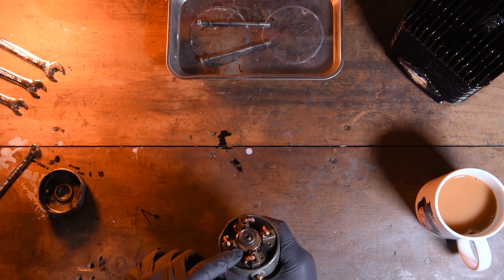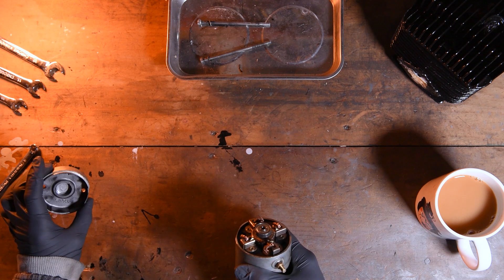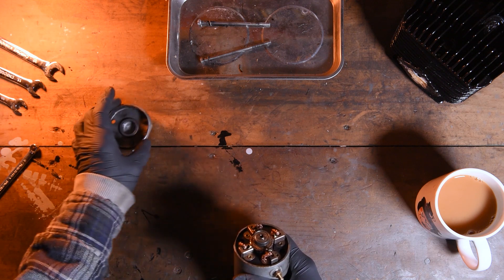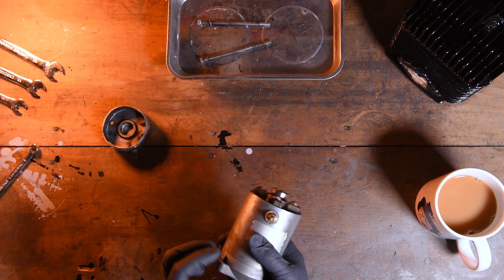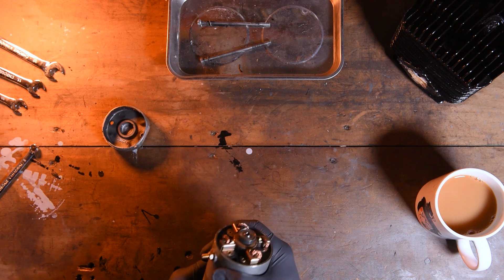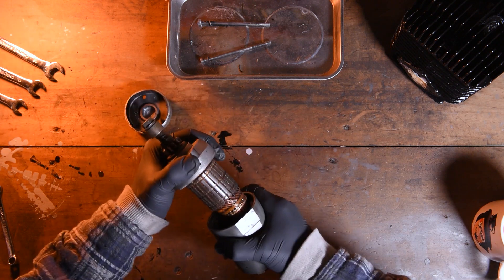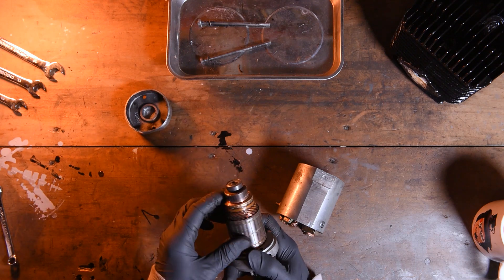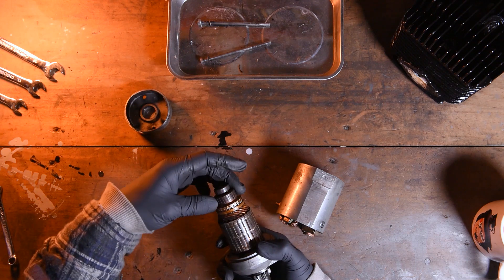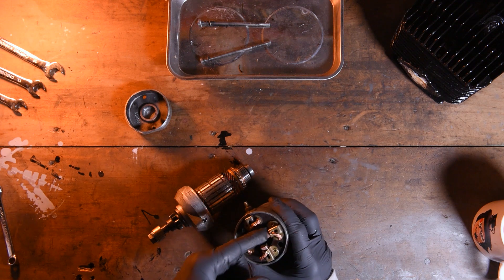It's probably going to be ever so slightly stiff so just work it off with your hand like so. That shows you all of your brushes and the solenoid inside. As you take this apart, carefully take bits out and make sure you can see where they go — there's no point in rushing this because otherwise you'll lose bits. Once you've taken this end cap off you should be able to pull this front piece off, and it should come out like that. A couple of main reasons why these starter motors go bad is because this contact point at the top gets all clogged up, and these brushes also wear down so you aren't getting a good contact between the two.